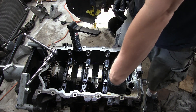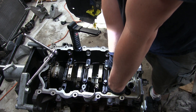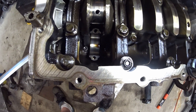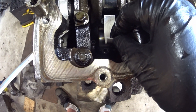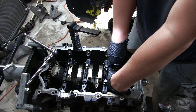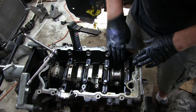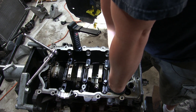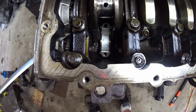I'm going to reach in — smaller hands would be a benefit here. I'll pull up the cylinder a bit, swing it out. I've sort of swung it out this way from my angle, then I drop and press in the new bearing — like that. This is what it looks like now.